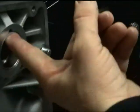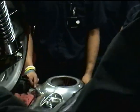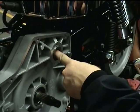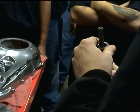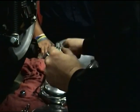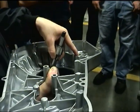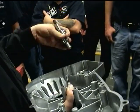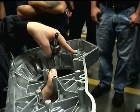Some areas you need to be careful of: this surface is pushing right here. If you get a little burr on that, or if you get a burr on this, it will actually get hung up, and that causes starter problems. Likewise with this surface here — make sure it's a nice smooth surface as it's going to engage. If this bushing likewise has a little burr on it, or if you forget to bend that lock tab over on the bolt, this won't engage because the lock tab will actually hit the side of the case. And if you keep hitting the starter, it's going to jam in there. So you need to be careful of that.